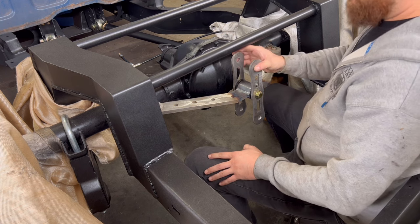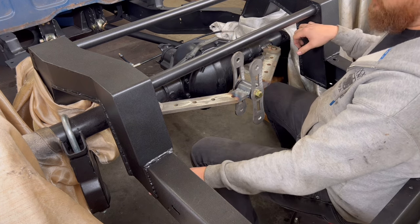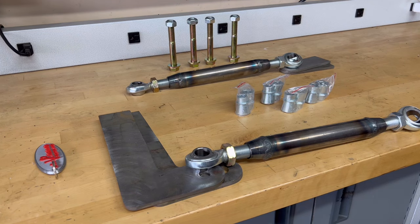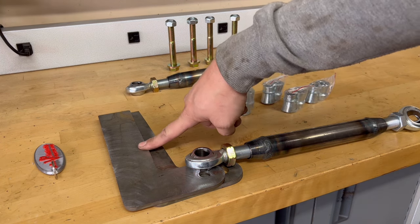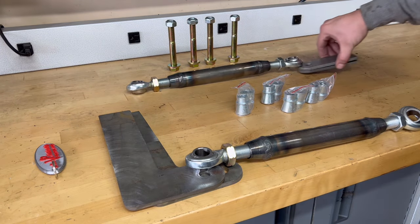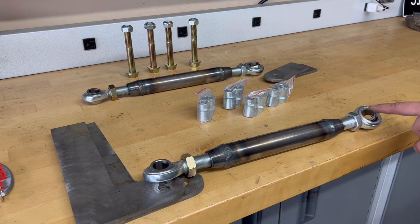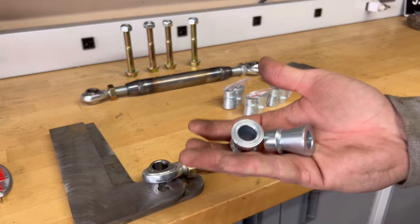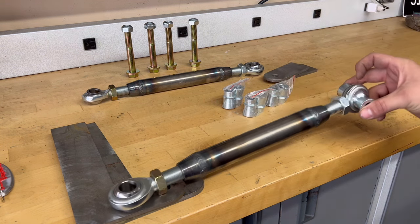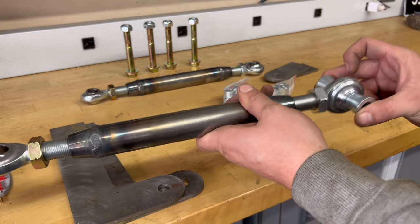Now I'm going to get those link bars, go ahead and install them, then attach the little brackets that weld onto the frame to eyeball it and see what we've got. The parts we have left: the two bars, the driver's side mount that goes on the bottom of the frame — we can cut this to any length we need. Then we have brackets that go on the side of the notch. The upper bracket bolts into the part we just put on, and a pair of these go on both sides. A bolt goes through here for flexibility going up and down.